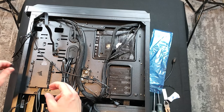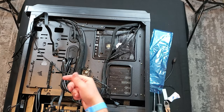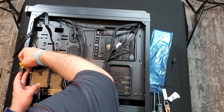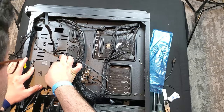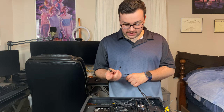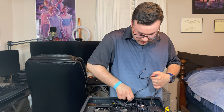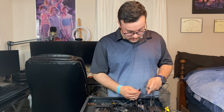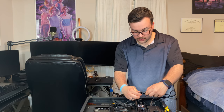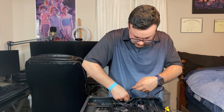In order for you to mount the RGB one, there's a little clip right here, and that's where it goes into the hub. So we'll do that for all three, for RGB and for the hub. So now it's these things. Now I do have an available SATA, which I don't have a problem with right here. So that can connect right here. From me installing the power supply, this can literally go like that, and I can shove it in here.